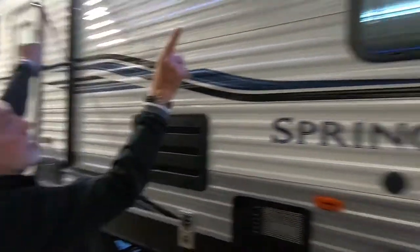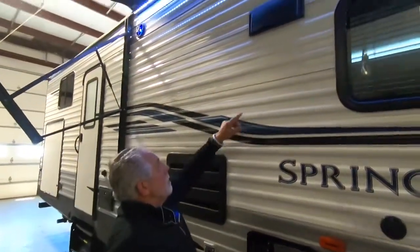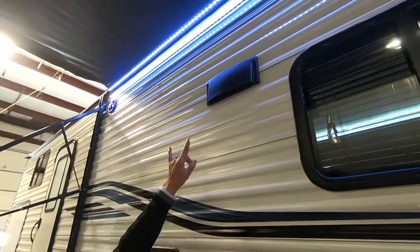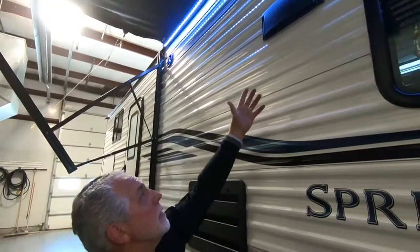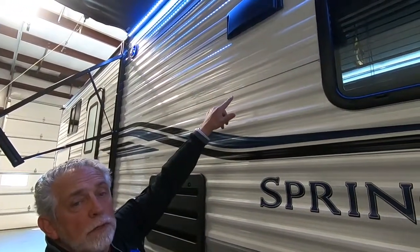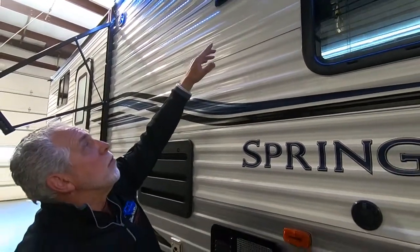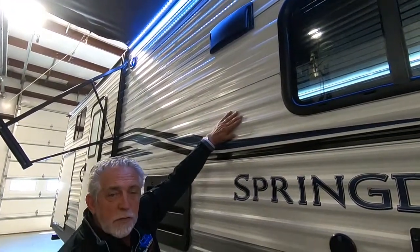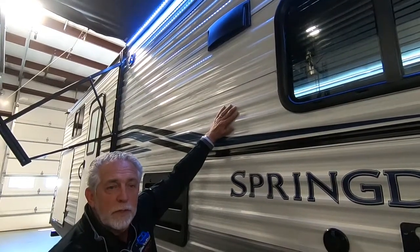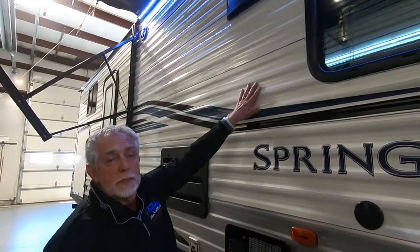You've got outside speakers up there, all lit up in pretty blue. You have your stove top vent right here — it's got a little door in there that snaps shut and open. When you're camping, make sure it's released so that when you turn on your stove top vent fan, it'll blow the door open and work as a vent fan. When it's not in use for an extended period, just get up there and snap it shut. That keeps insects from trying to climb in and make a nest in your vent duct.